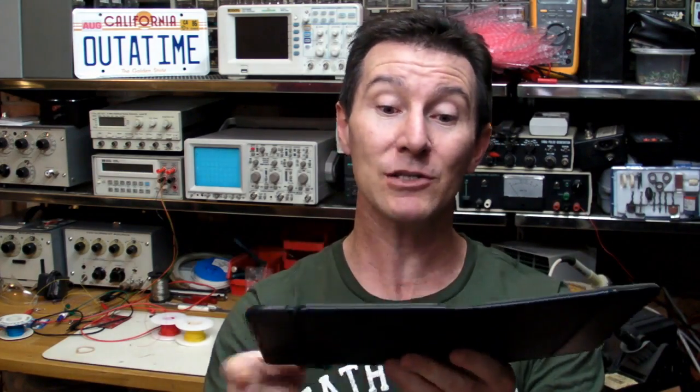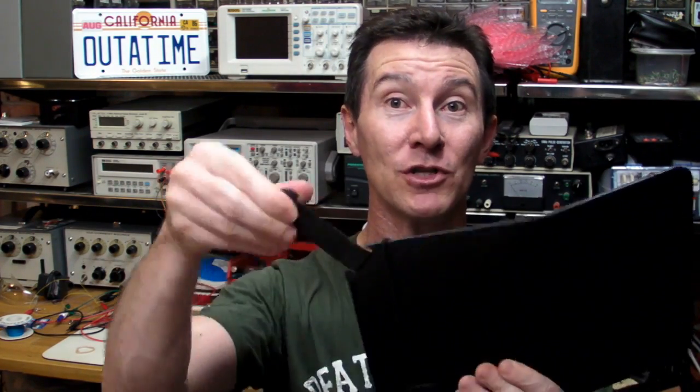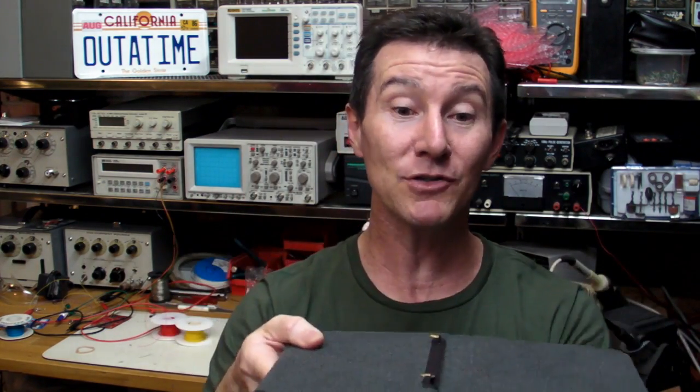So, what is it? Well, I don't know. My next best guess would be ESD — electrostatic discharge — possibly caused by the case or something coupling into the contact terminals. But why does it only happen on the non-LED version? This LED version apparently doesn't get this problem, but the identical version with black-painted tabs does. I've tried some ESD stuff and can't kill it at all, but I need to do further investigation to try and figure it out. It's definitely not the tabs. I hope that's cleared up all those comments on Slashdot thinking it was that. I'll keep you updated if I find anything further. See you tomorrow.